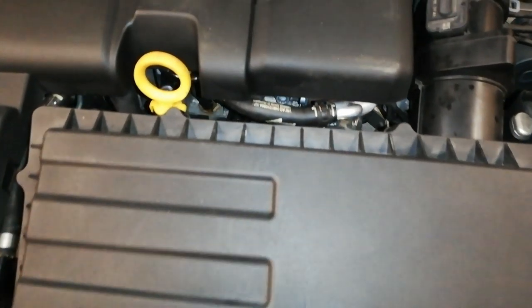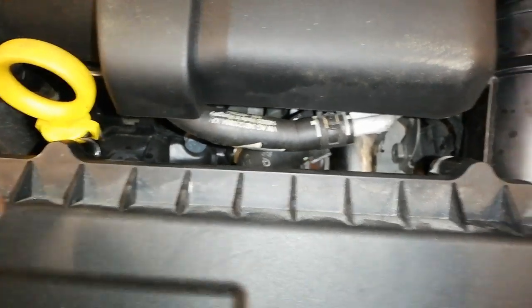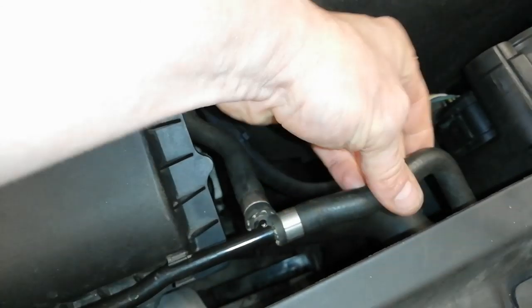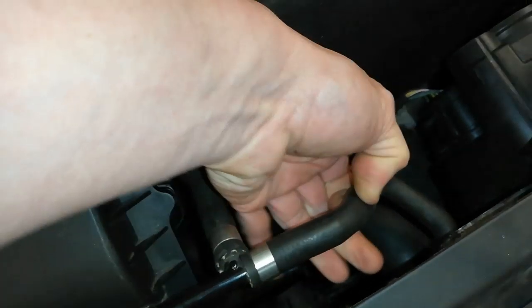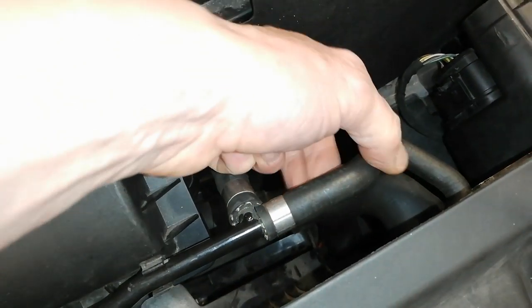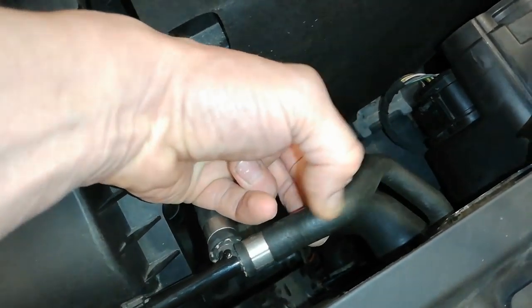This water pump runs on a hydraulic action from the coolant itself. There's a diaphragm that moves about and sucks the coolant into a small hydraulic circuit inside the water pump. A solenoid opens and closes like a wee valve, putting a shield around the impeller or taking it away when the ECU commands it, depending on coolant temperature. It's a complex system — testing flow is a nightmare because these three systems can run independently of each other, which is done by having non-return valves all over the place, and sometimes they're pretty hard to detect. There's an arrow on one pipe there — off the EGR cooler — and if you feel it, it's hard in the middle. There's a blockage, nearly. Another pipe has no markings but you can pinch it and feel it's solid — that's another non-return valve.